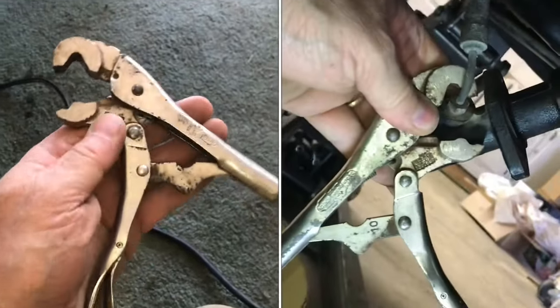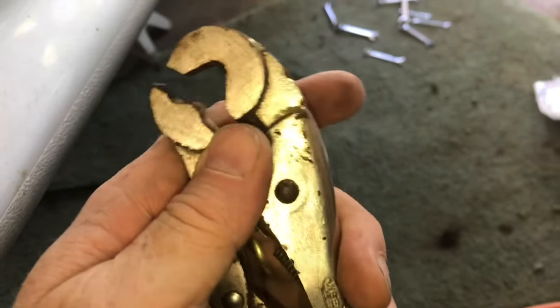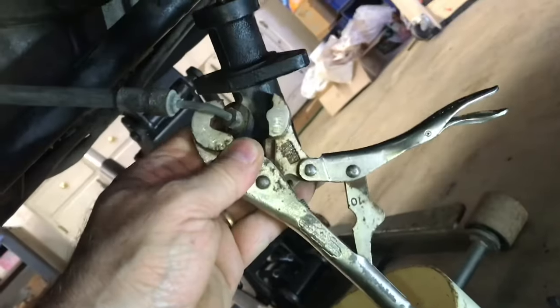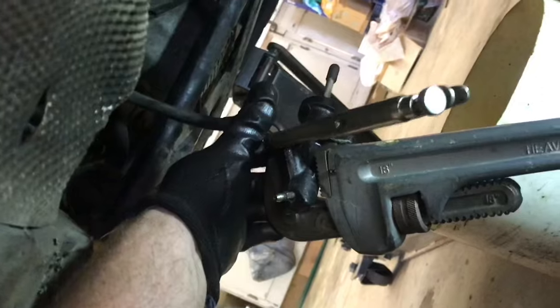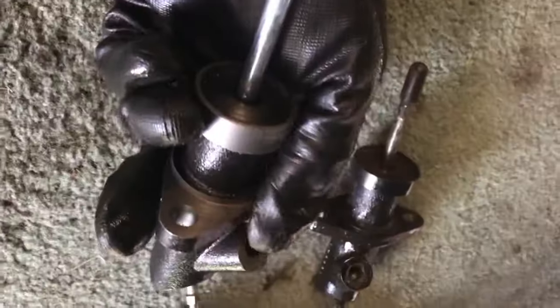To break the hydraulic hose loose, I like to use a vice grip like this. I find this configuration works better than any wrench I've used — it'll fit nice and tight on the bolt. I used a pipe wrench to hold everything steady. Remove the fitting, remove the slave cylinder, then thread the fitting back into the new one and snug everything up tight.